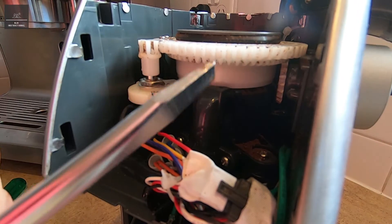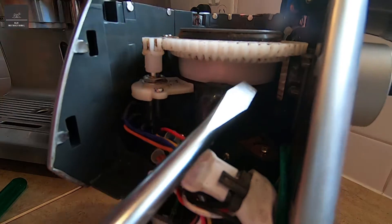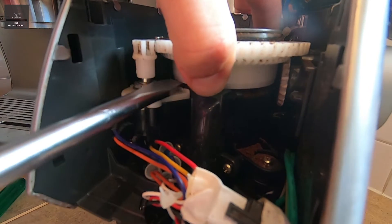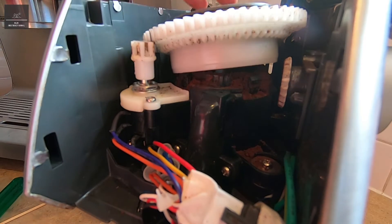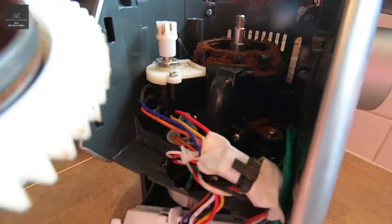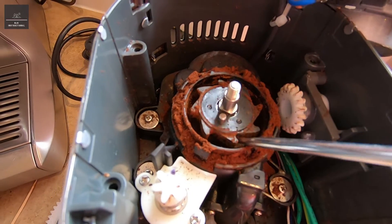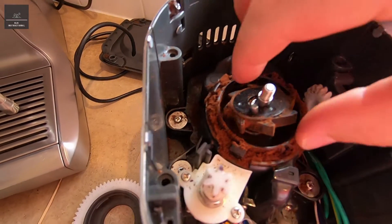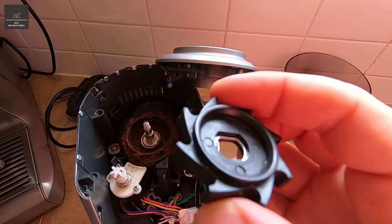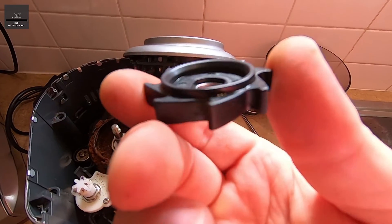This part's a little bit tricky. I'm going to get one of my thick blade screwdrivers — the yellow type — and go underneath the gear here and lift up, then again on this side and lift up. That way we can actually detach this white gear. Now you can just use a regular screwdriver and this should just slide out. So I've just given the impeller a quick rinse, and on the surface it looks okay — it doesn't look like it's actually worn out anywhere.